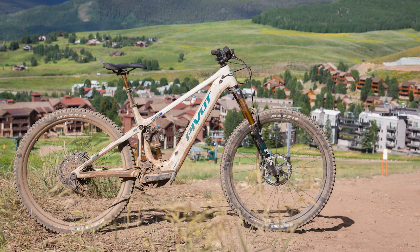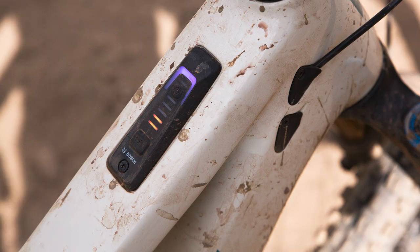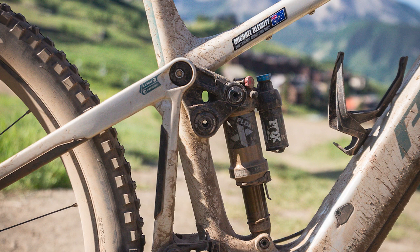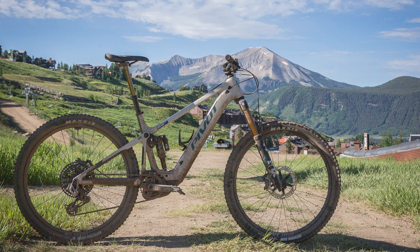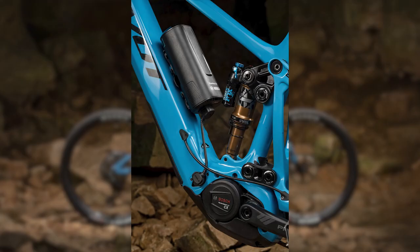There's been an update in geometry — it's a little bit longer, and partly that's to accommodate the Smart System battery in there too. It is also lighter, and overall it's a tiny bit slacker with a slightly steeper seat angle, so you get the geometry changes you'd expect on an updated trail and all-mountain bike. Another change is it opens up the main triangle a lot more, so you've got room for a bottle cage on the down tube, which also means you can fit the new range extender battery from Bosch if you need more than the stock 750Wh battery.